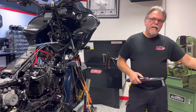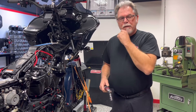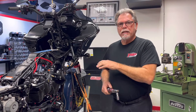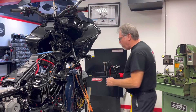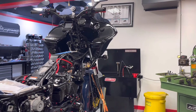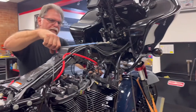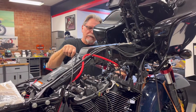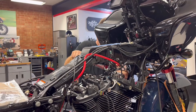Sierra will show you the order that I do it on the head bolts. We have not ever had an issue with head bolts since we've been doing it this way. So I'm going to 48 and I'll start over here on number one, and I just go right to 48 real easy with a nice steady pull. As you can see, it's a nice steady pull to 48.